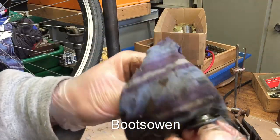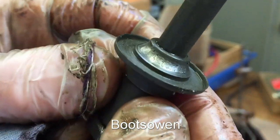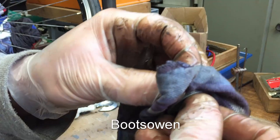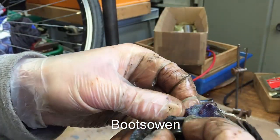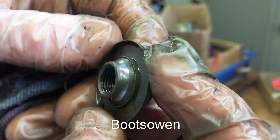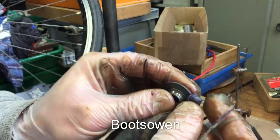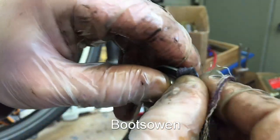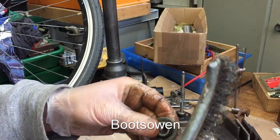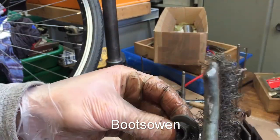See what the other side is like - yeah, that one's really pitted. It should be like this - well, even better than that. And then it looks like this. You can see the holes in it - it's probably been a bit of water in there causing it to rust. Let's have a look at this side. This one looks okay - good and shiny on the surface the whole way around. So it could be that half the ball bearings are dead as well. Mind your fingers on those, because sometimes those lips are pretty sharp. I'm wearing plastic gloves but I've cut through them just as quick as skin - there's no protection from anything beyond oil. Right, so I'll go fishing and see if I've got parts.